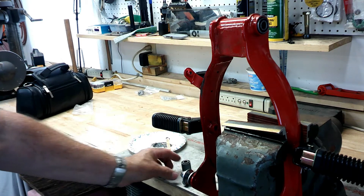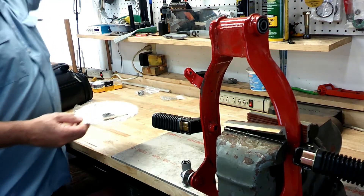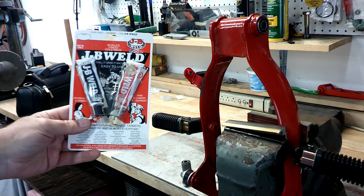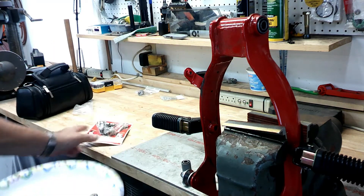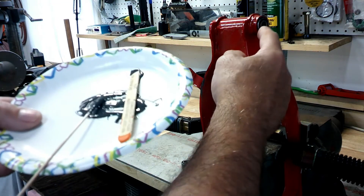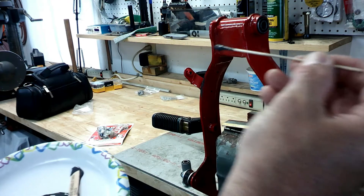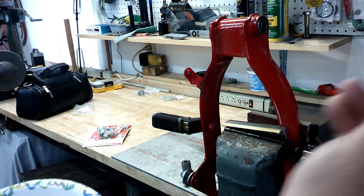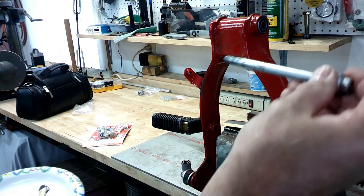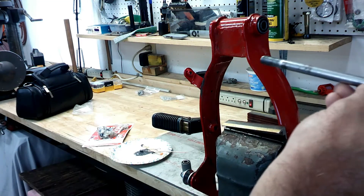So what I've attempted to do — I don't use JB Weld a lot, but in this case it's just the ticket. I went ahead and mixed up some JB Weld, first cleaned the inside of the bushings real well, then took a Q-tip and worked a good amount of it in there, twisted it around. Right after I did that, I stuck the bolt in as far as the shank and then pulled it out.